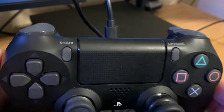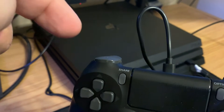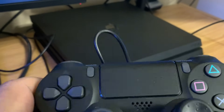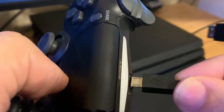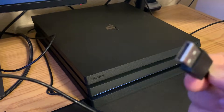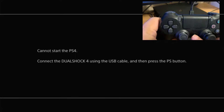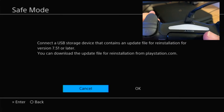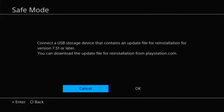You can look around your house to see if you have another cable, but if you don't I will leave a link to a compatible USB cable down in the description below. Now I'm going to connect my compatible USB cable to my controller and to the PS4. You'll see that when you press the PS button you won't see that flashing orange light anymore, and then your PS4 will go to the next screen.